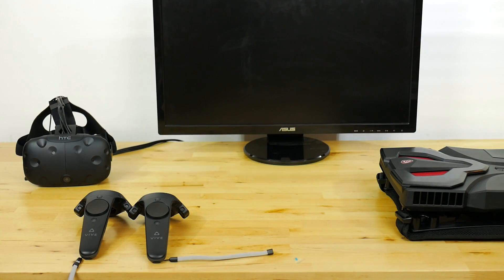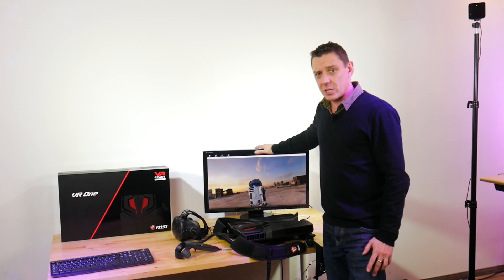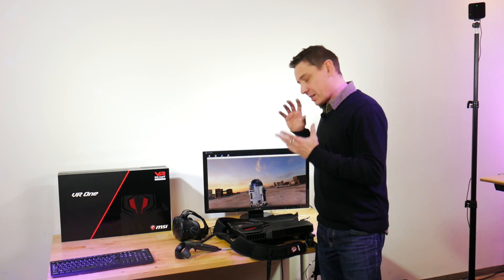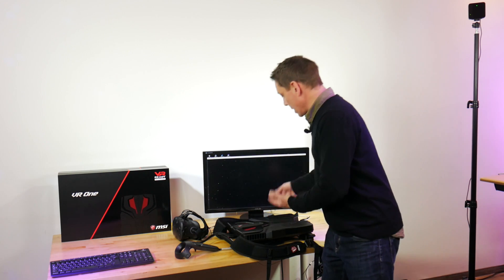When you get the backpack and take it out of the box, the first thing you'll need is a monitor. MSI have got a couple of options for you. You'll need to plug in a monitor via HDMI or DisplayPort and then configure remote desktop, so you can use a separate laptop or PC to connect to this device over Wi-Fi. It's important that you have a wireless connection, because bringing it back to a table and connecting DisplayPort every time you need to change something in Windows is difficult. You can do it through the HTC Vive system.